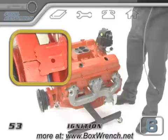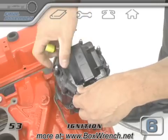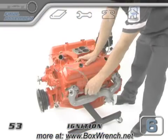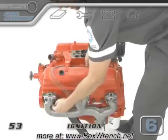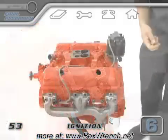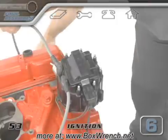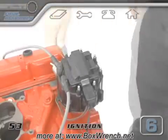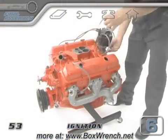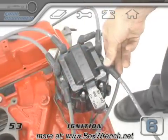The first one is easy. Right now we're at the moment of spark for number one, so we connect the wire from the tower with the mark on it to the number one spark plug, and every time the rotor hits that point while it's spinning, the spark will go to the number one cylinder as the engine runs. This distributor rotates clockwise and the next number in the firing order is 8, so the next tower in the clockwise direction gets connected to the number 8 spark plug. Continue on through your specific firing order, and do your best to judge the lengths of the wires as you go so that you don't have too much or not enough slack when you get to the last couple.